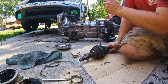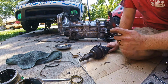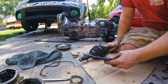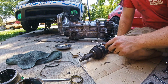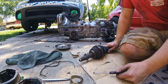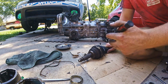because the same thing with our axle stub bearing, we have our wheel bearing that also needs support. And so if you're not running an axle in the front, the wheel bearing can shift around side to side. So we are going to pull these off, and when we're done, we'll slide these into the wheel bearing and in the hub assembly and tighten them down with some Loctite. To pull this one off, these ones are aftermarket ones, so they're set up a little differently.